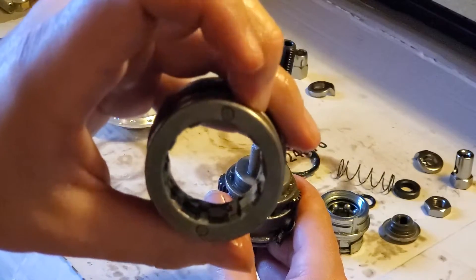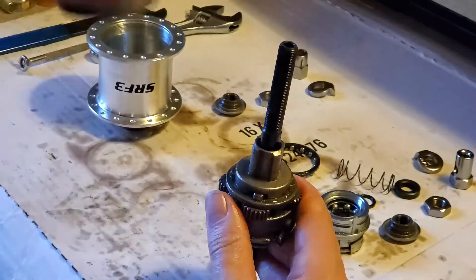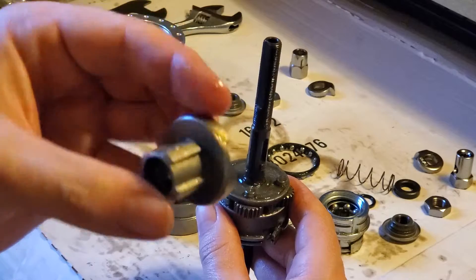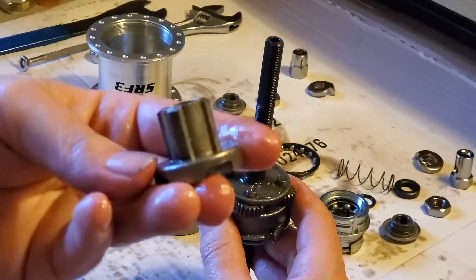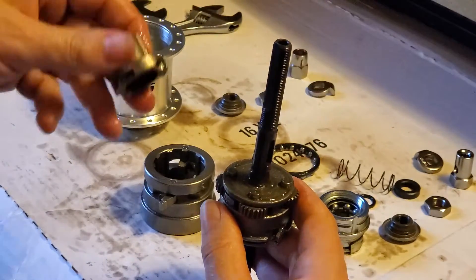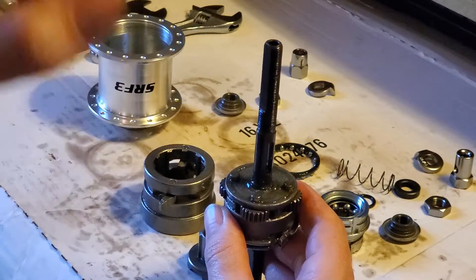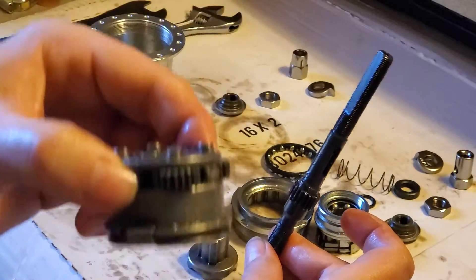The pawls have these little tiny springs like the older hubs have, so it's best to hold the ring gear like this. Pull off the clutch — the clutch is a little bit different. It has a round profile, it's all one big piece like a hat, a big hat with keys on it. The keys go into that driver. The actual axle key that goes to your indicator chain is just a square piece, and then the planetary key just comes off like that.